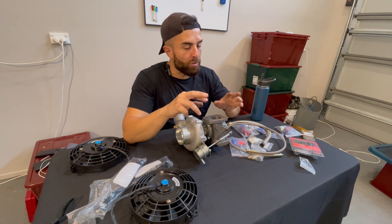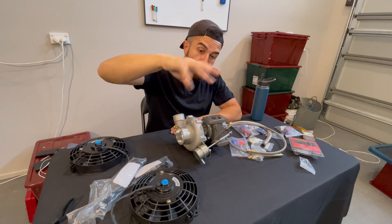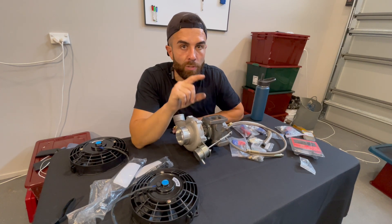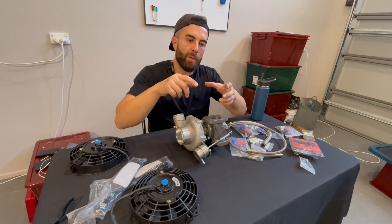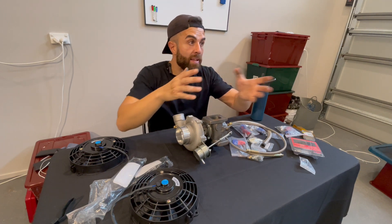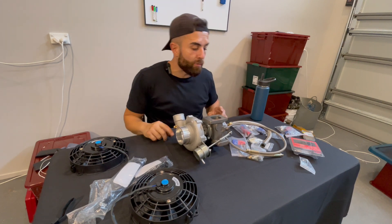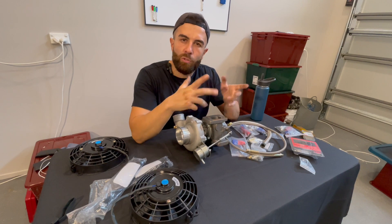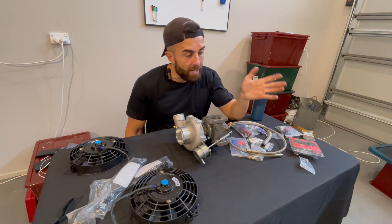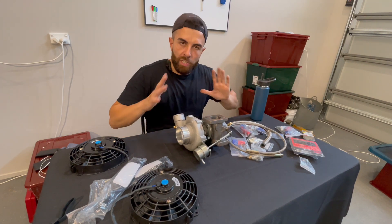A second option: if you have an 80mm gap on top of your oil filter, there's an oil sandwich plate adapter — for example SAS make them. You basically fit this plate with a new thread, and your oil filter winds onto this in pretty much the same location as your factory oil filter. You do need the clearance or you can't unwind the oil filter. They have two outlet ports and they're not too expensive — about 30 bucks. That could be an option if Hyundai put the oil pressure sensor in some awkward location.